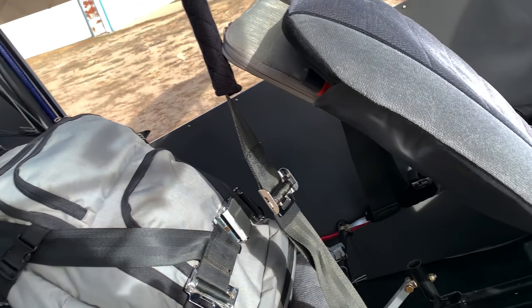I've got to change out some EGT probes. Some of you guys have asked about the MGL instruments that I'm running — I've got a whole bunch in my panel, and I had some in the last bird. Great instruments, never had a problem with them. They're pretty customizable — you can run different kinds of senders with them, some are user programmable, there's a decent amount of flexibility. However, I've been buying MGL's EGT probes because they thread right into the 914 or Edge exhaust, and I've just had a ton of trouble with these. I've probably had four or five quit — they just keep giving me issues.